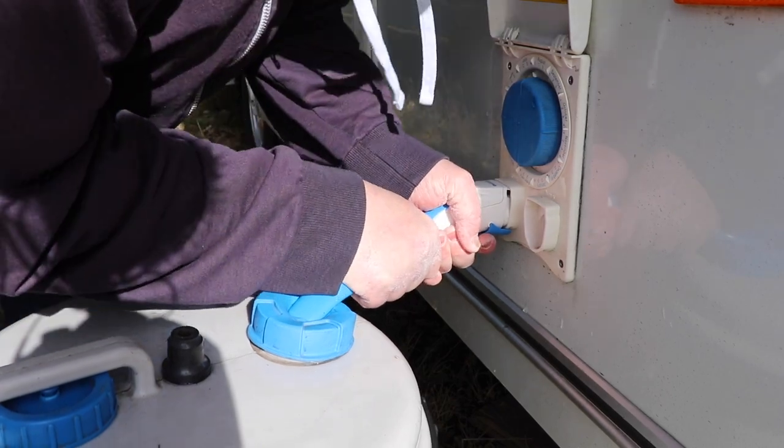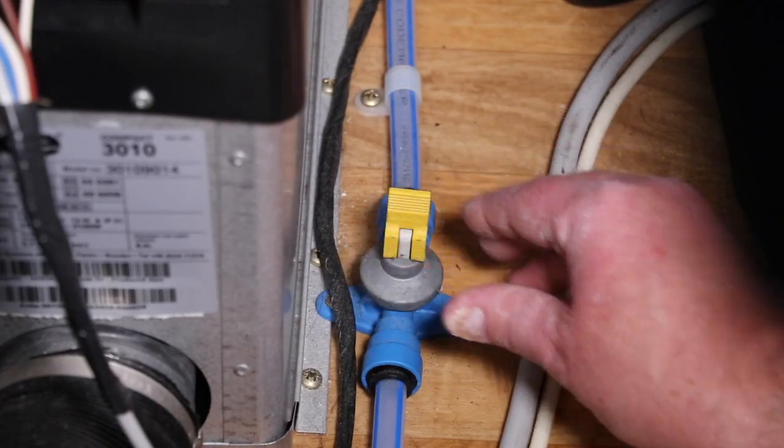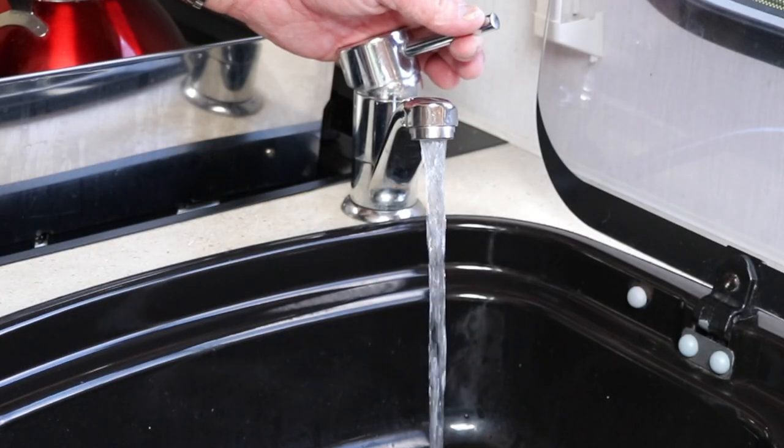Connect the aqua roll as if you were going to fill up the caravan water from dry. Here's a crucial step: if you have a charcoal-based filter — we have a Truma Ultra Flow with a charcoal water filter — drop out any filters and take them out of the system, because PuraClean will cause the filters to break down. With the water hooked up and the filter removed, close the drain-down tap, make sure all taps and the shower are closed, then prime all the taps as per normal. If you have a hot water tank, make sure it's full, but don't switch on the hot water — leave it cold.